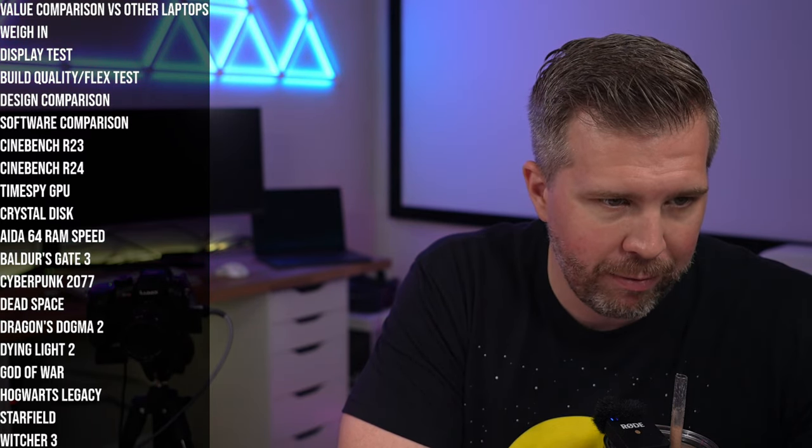Another one that's new for 2024, on the cheaper side, we have the MSI Cyborg 14. This has an i7-13620H, an RTX 4060, only 45-watt TDP, I believe. Yes, it is. It's got a cool look with the blue keyboard. It's got the same chassis as the MSI Stealth 14, but it's transparent plastic, and I believe a metal top lid. I saw this at CES, was hands-on with it. And most importantly, the display quality is better: 100% sRGB and over 300 nits, according to the MSI reps when I was at CES.